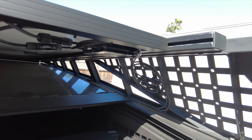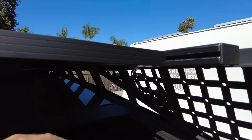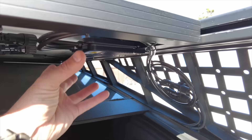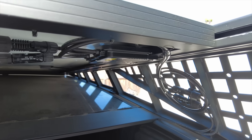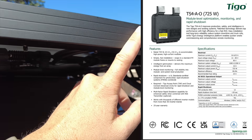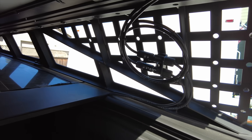When I get into 2.0 and 3.0 of the system, I'll have another panel sliding out one way and a panel on top sliding out the other way. At that point I'll definitely need optimizers, because when the panels are retracted two of them will be shaded most of the time. An optimizer bypasses shaded panels and continues using the panels in the sun, so you'll need a couple of those with three panels.